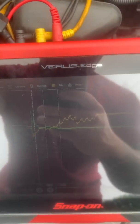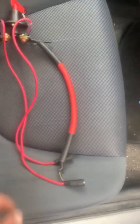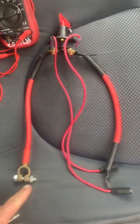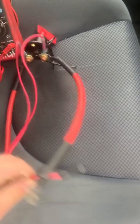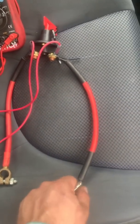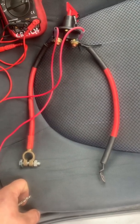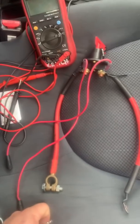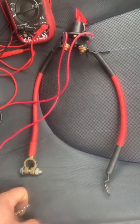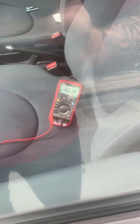Let's carry on and check our battery drain. I've got this little tool I made up - all it is is a battery cable with a kill switch in the middle, so we can put our amp meter in series without the modules dropping out. This wasn't actually my idea - I picked it up on a training course from John Batten down at Auto IQ. We're back to this car now and we've had this set for the best part of two and a bit hours.